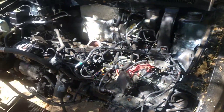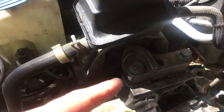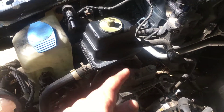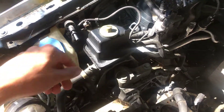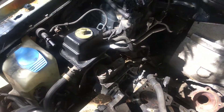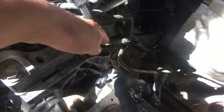Let me show you the engine mount. You need to disconnect the engine mounts. They say that you have to replace all the engine mount bolts — that's one thing to keep in mind when putting this all back together, because these are stretch bolts. Once they stretch they could break, and I've seen videos of what happens when you don't replace those bolts — it's not pretty.